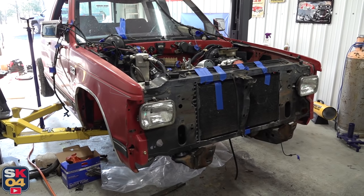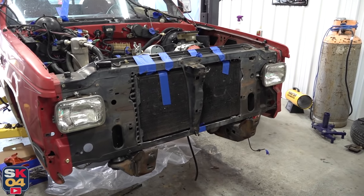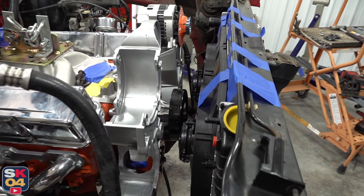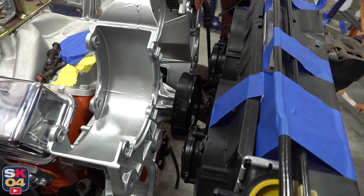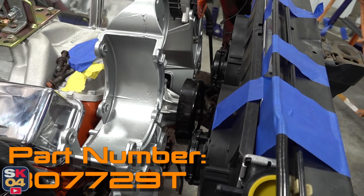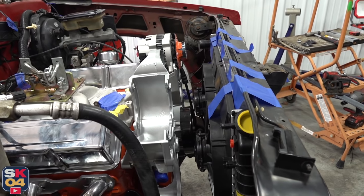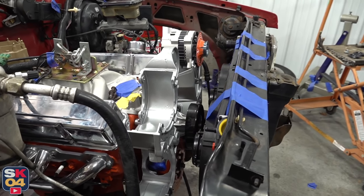For the moment, the fans, the radiator, and the condenser are just sandwiched together and held in by tape. This is just a very basic test fit. In case anybody was wondering, when using this style accessory drive and serpentine system, the correct pulley to use with the Corvette short water pump is actually a Mer Cruiser pulley — same bolt pattern and everything. All you have to do is bore out the center hole to three quarters so it can fit on the shaft properly. If you try to use the original pulley that came on the tall water pump, the offset will be wrong and the belt won't line up. This pulley puts the belt exactly where it needs to go and it's not that expensive of a part.